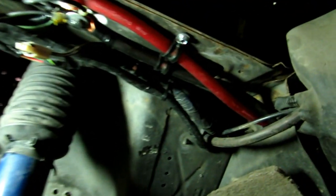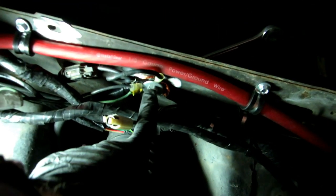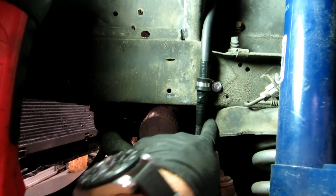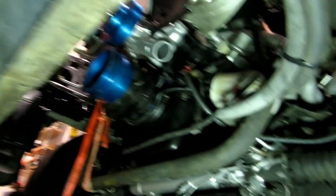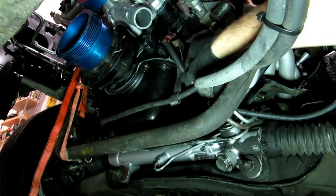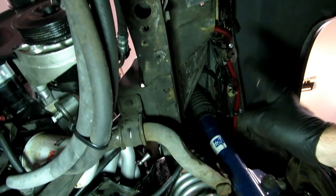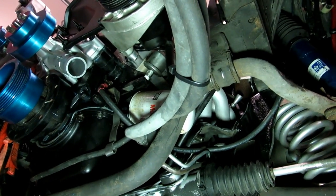The battery cable is going all the way to the trunk. We've got our power cable, our ground cable goes to this ground spot where every engine harness connection is tied, and then we've got another 4-gauge cable going back, tied to the frame - it'll get tucked underneath once the engine mount is bolted. That goes straight to the engine block. I've got a 4-gauge cable going straight to the battery and to the side of the engine block, so there's no doubt the chassis is getting grounded in two spots - front and back. I'm also going to tie in the back of the engine block, which pretty much ties up the wiring.